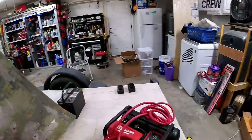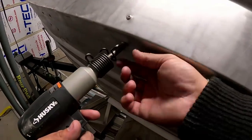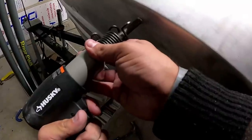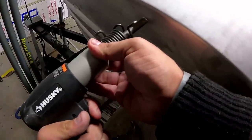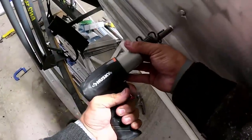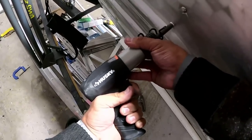There are also drill bits specific for rivets because if you get the hole at the precise buck rivet size, that's the best chance of longevity. If the hole is bigger than the rivet head, that's prone to leaks. Towards the end I started using some 3M 5200 in there to help seal it — it was already kind of sealed together. So there's sealing between the ribs and the hole, and now there's a little more. This is the best it's going to get — it's either going to leak slowly or not at all. Once I epoxy and it gets deep in around those rivet heads, I think we can stop the leaks.